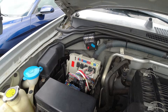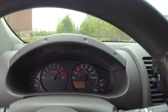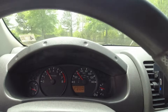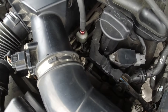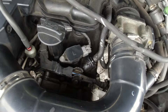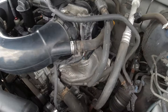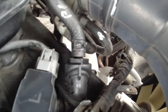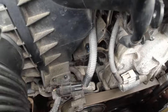Now go for a test run. Take the truck around for about 10 minutes to check for any hesitation, idling problems, or check engine lights — it should be smooth driving. After the drive, go under the hood and check for any leaks: no fuel leaks, no water hose leaks, no vacuum hoses getting stuck, and nothing vibrating against equipment. Everything looks good — that's a very good sign. If you found this video helpful, please like and subscribe.